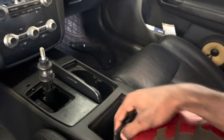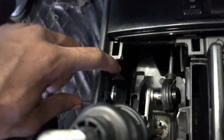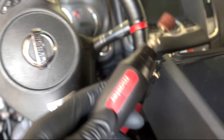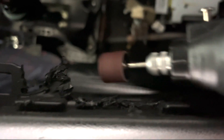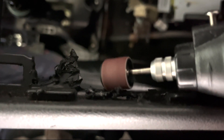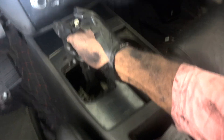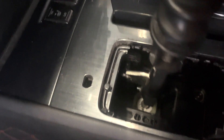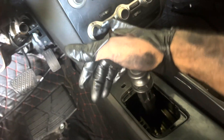I'm going to go straight to the interior. Nothing is bolted down so I'm just going to lift this up. I'll probably need to trim this area a little bit better because the shifter currently rubs on it when I move it. A little 12-volt drill work — a little longer than a few minutes later — I was able to get the shifter down with the washers. Everything pretty much clears in terms of motion. It touches slightly when I go to the right, but that's all plastic and it's not going to stop me. I really won't know until the transmission is in and I try different gear ratios, but as of right now we're good.